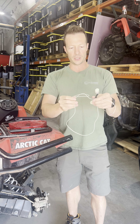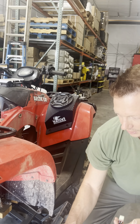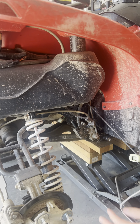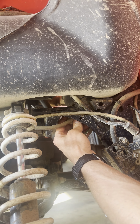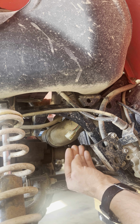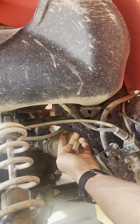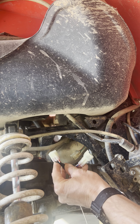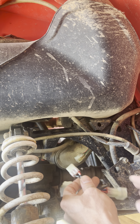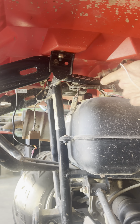You are supplied with this wire harness from us, and you're going to plug this six-pin connector, this jumper, in down over here. You don't have to take your wheel off, but I did that so you can see. Down in this area, on all Arctic Cats, is this six-pin connector. It's kind of hard to see, it's tucked up in there. I already unplugged it, but it's just a standard six-pin connector. You're going to unplug it, and then plug this wire harness in line there. Plug it right back in to where you unplugged, and then run this wire all the way up through everything carefully.